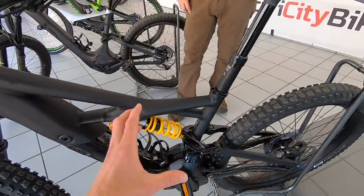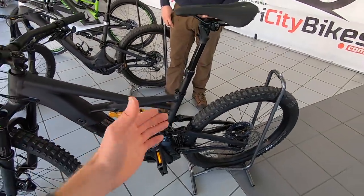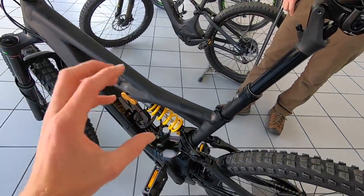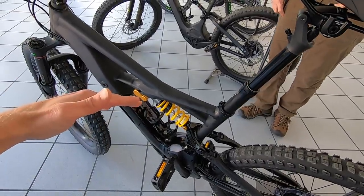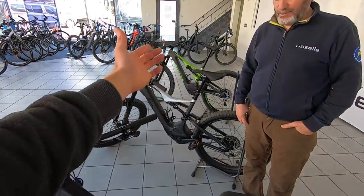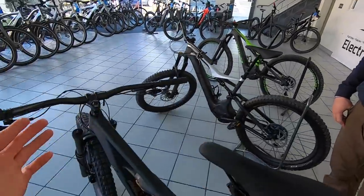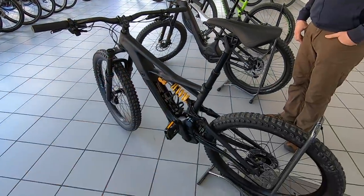It's this big spring. And they said, when you're really going down, I mean, this is an enduro bike, and you could probably use it for a little bit of downhill too. When you're compressing that hard and fast a lot for a longer descent, the air in these air suspensions can heat up, and that can change the profile, because as air heats up, it expands. Yeah, it changes the characteristic. So it's a matter of what kind of riding you're doing, what you really want to optimize.